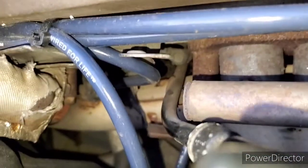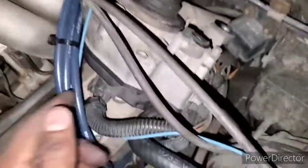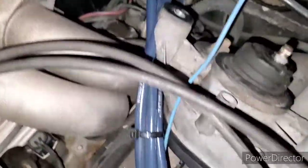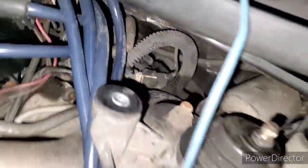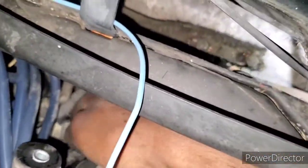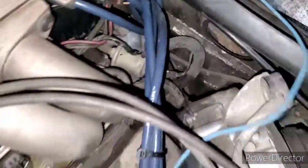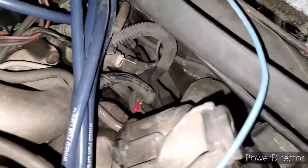When you're installing the oil temperature sensor wiring, you're gonna have to take off the wiper motor, because Chevy had a bright idea to put your oil sensor right in front of it. You'll need three 10mm bolts removed and then a 13mm to take off the nut in the back so you can reach the sensor. I had to take the motor off because it recommends you wire a new line for the oil temperature sensor.